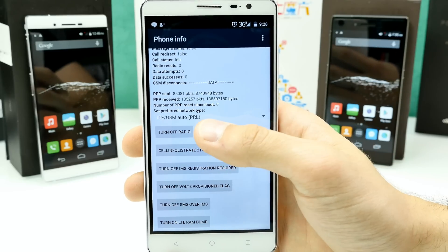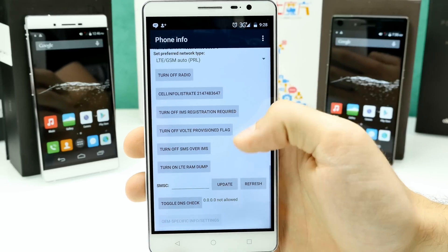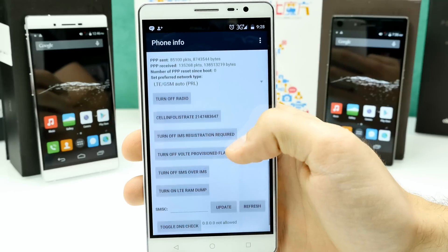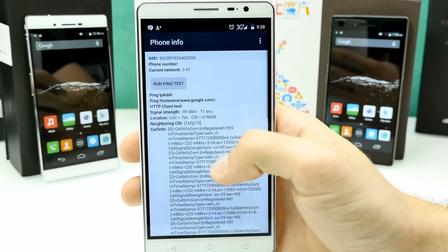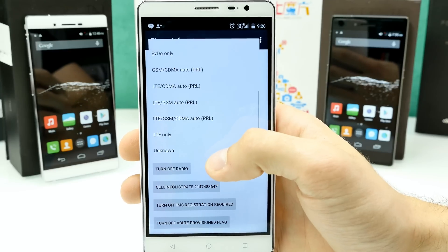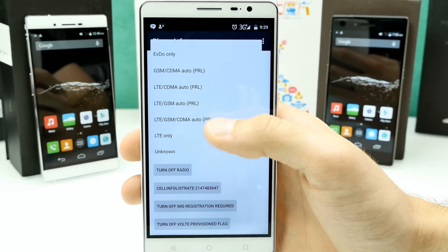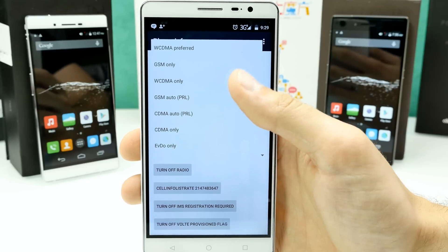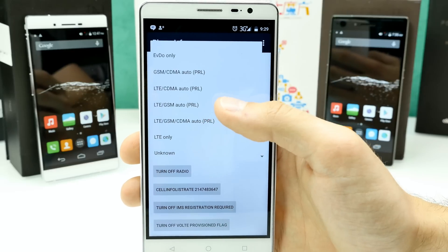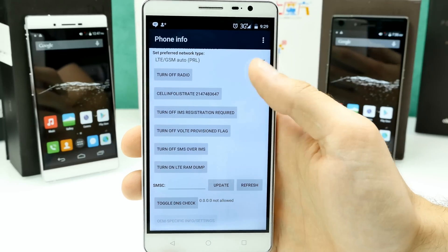In these settings you can turn the radio off and back on again, and reboot the phone if it's not saving the settings. You can also turn off IMS registration if required, and keep the rest normal. The main things are: switch the preferred network type — I know it's confusing that LTE or GSM was the only option that worked for me. WCDMA and other 3G options weren't connecting, but switching to LTE and GSM did it. I'm not really sure why, but I'm happy it now works so I can do the review.